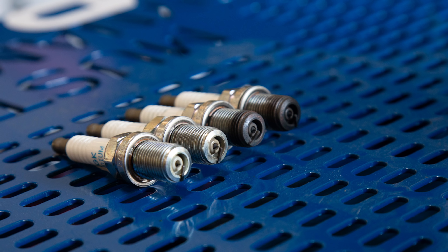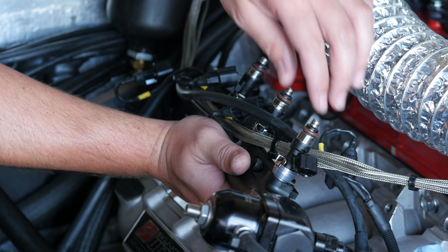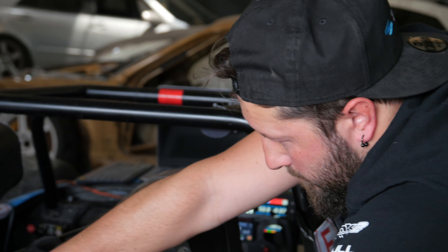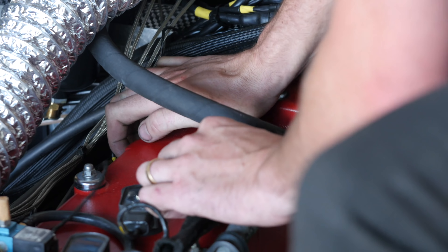The fact that the plugs are still looking brand new evidences this, given that these were a fresh set of plugs fitted to the engine. The spark plugs however are wet with fuel, so we do know that there is fuel getting into the cylinder. We've gone through and performed a spark output test and an injector output test on the M1 ECU, and this confirms that the coils are actually firing and we are seeing spark.